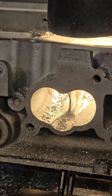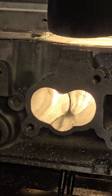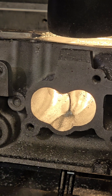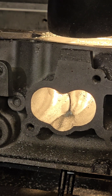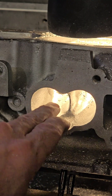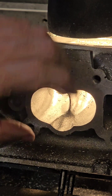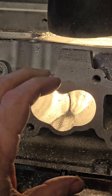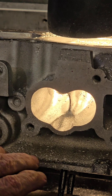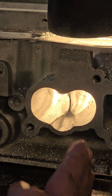This is a great example of why CNC will never do as good, because that port's nearly on size — this wall's almost parallel but that wall isn't even close to parallel. So this wall comes in and curves out, and this wall's almost dead straight, but the CSA is now almost on target. That's the key with hand porting versus CNC. If CNC would go and rip that whole wall out, it wouldn't touch certain areas of the casting because there's no casting there to machine, and we end up with a bigger cross-sectional area on one side than the other — more area than we need.